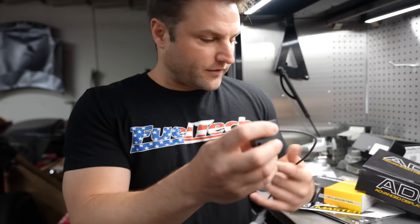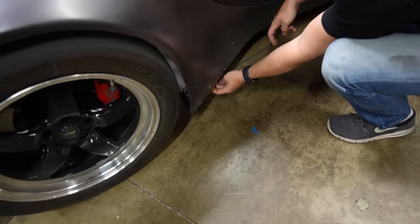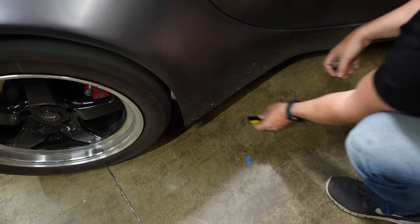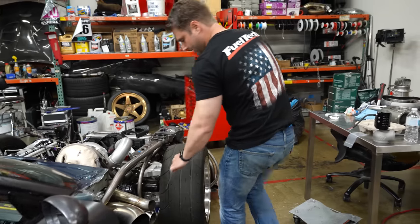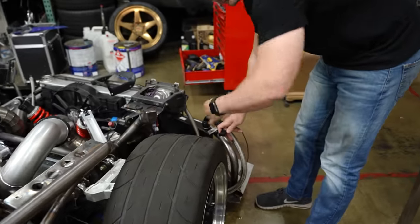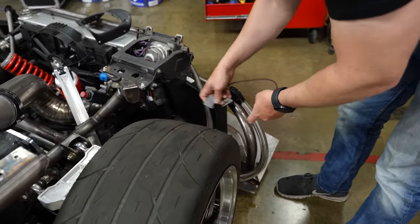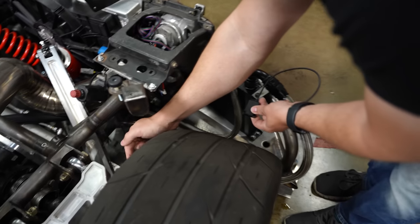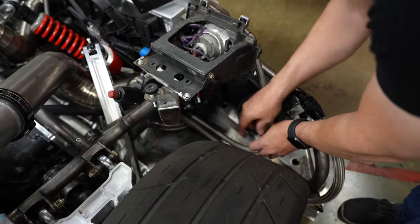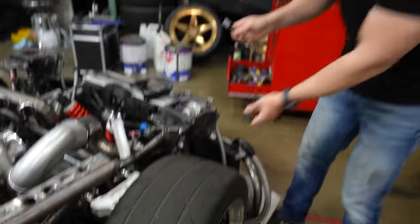The only thing that I'm gonna have a fun challenge with is, like the 3-rotor, I'll have it somewhere mounted inside of the fender, angled at the correct angle so that way you get the correct width of the tire. And life is good on the rear. The front though, think about what's going on: if I mount it like this, as the tire turns, the numbers will change. And so I'm wondering if maybe hooking this on to some sort of upright metal or carbon composite something or another, so that this swings with the tire, so that way you always know the temperature of the tire and this stays constant with it.